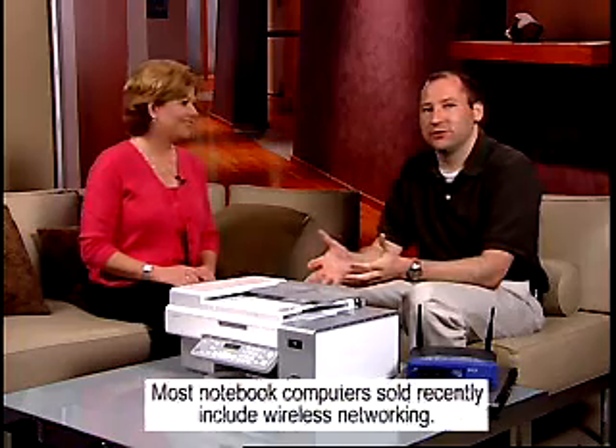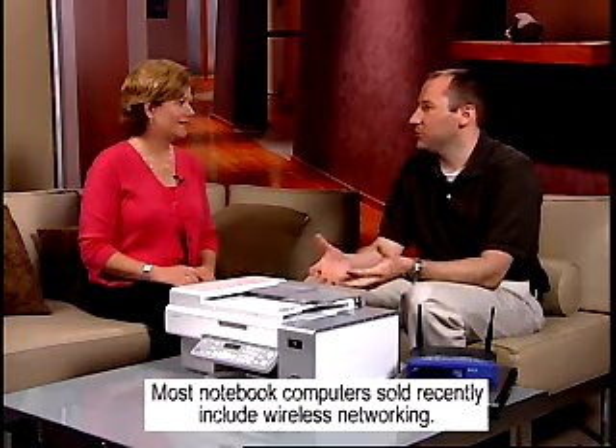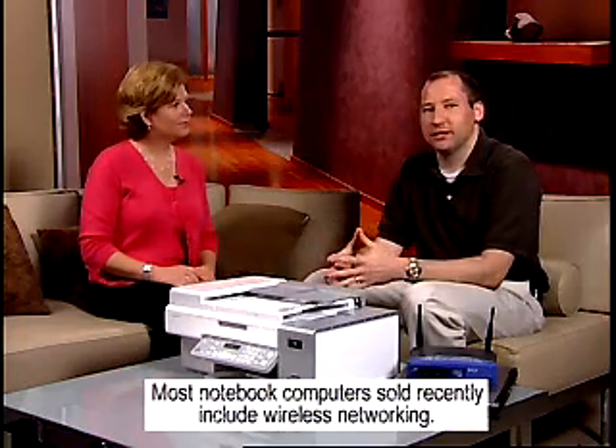So what do we need to get started? First you'll need a wireless computer — almost every computer built in the last three years has a wireless network card included. Next we need a wireless router. You want the router and the computer's network card to both be speaking the same language, so make sure that both the router and the computer are 802.11 compliant. Do you need to have internet access to make your network work? Well, you don't need internet access to make the router function, but it does make your daily tasks much easier if you have high speed internet access.